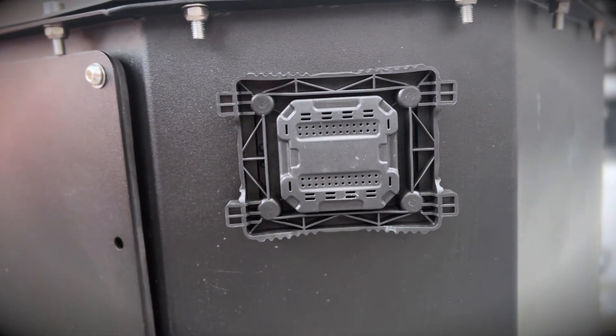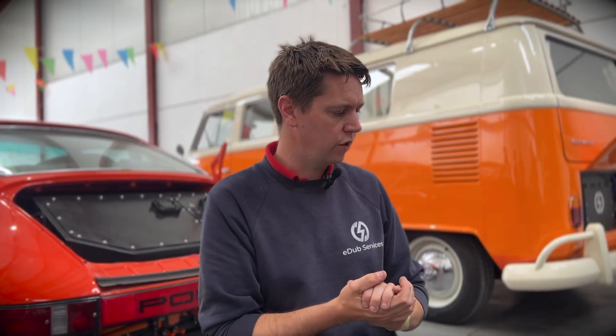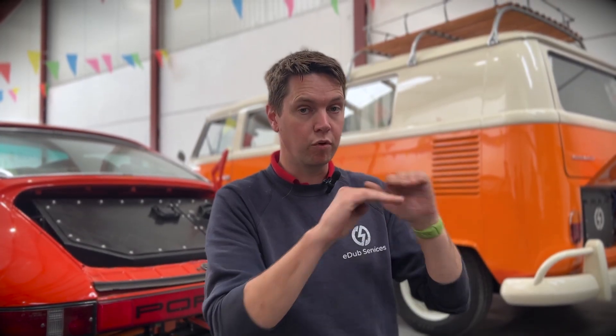We have our battery blow-off valve as well. That's to help regulate the pressure inside the box, because the box is sealed to keep moisture out, but as the batteries warm up and change there's a little bit of movement, so to avoid any seals popping the battery blow-off will protect you. We've also got our safety disconnect, which is mandatory for electric conversions — a physically removable component that breaks the high voltage circuit. If the vehicle was involved in an incident, that's the first thing fire crews and emergency services can access, so we make it massively accessible right on the back of the box.